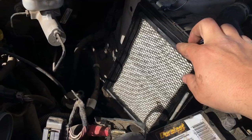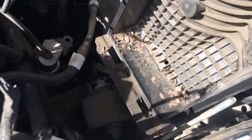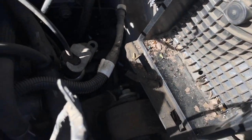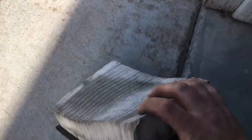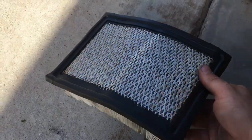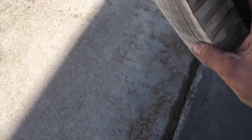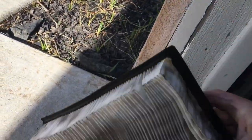It's a good idea to remove the air filter and take a visual inspection, then vacuum any debris out of the air cleaner and the engine compartment. A quick tip with these air filters: between two or three oil changes before replacing the filter, tap the air filter out to get any dust out of it.